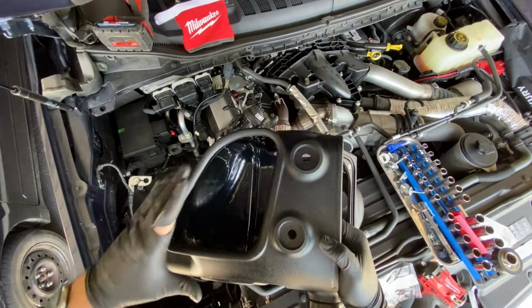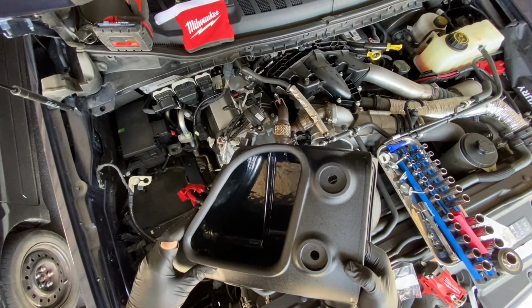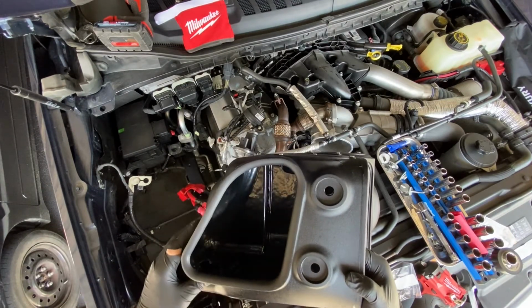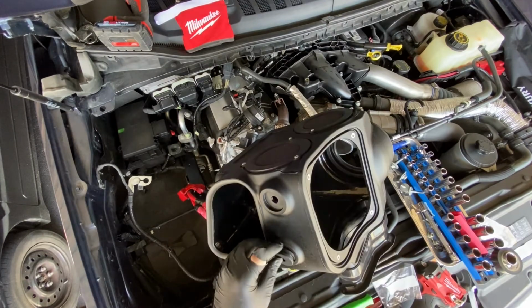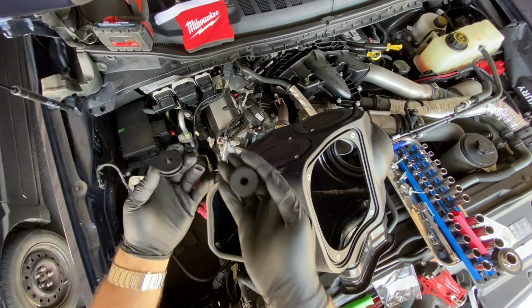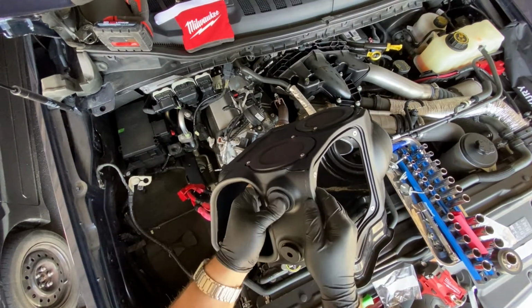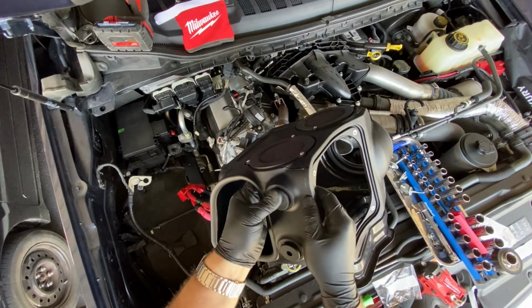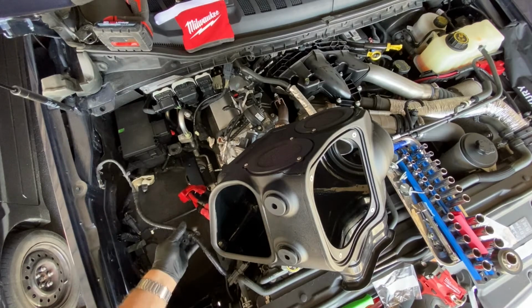Now on the side here, there's another rubber plug that you can install. It's up to you. I recommend you keep it off for maximum airflow. S&B recommends the same as well. You want to get your 2 rubber grommets and press them into the holes on the side, like so. All right, now we're ready to get the intake box in its home.